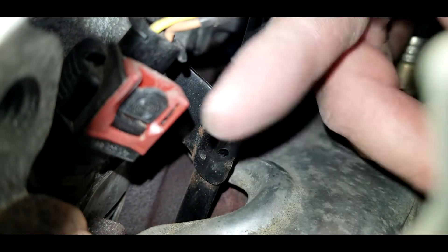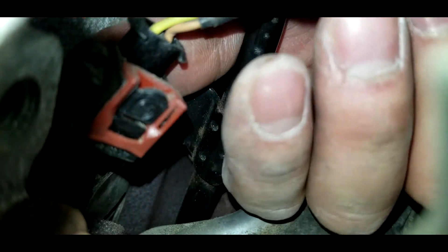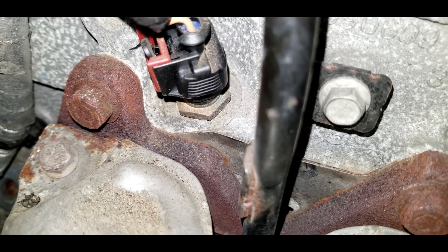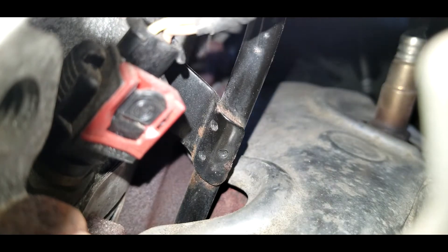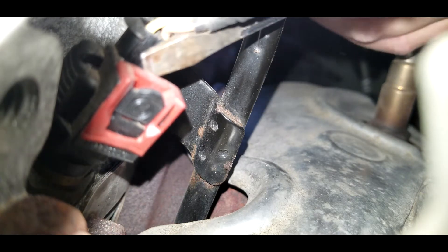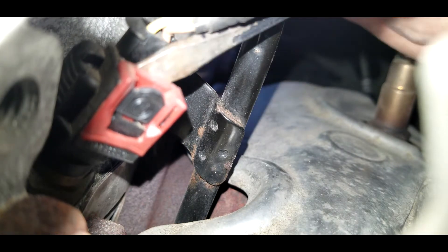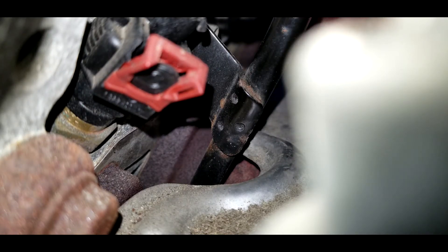Here I'm trying to take off the clip with my hands. I tried to take the red clip off with just my fingers — that didn't work. I tried pressing the button and pulling it — that did not work either. In order to take the wire cap off of the sensor you need to pry open the red clip. So what you need is a flat head screwdriver. I tried popping it from the top but didn't have a lot of room, so I decided to go to the bottom of it, twisting the flat head to try to make it come off. Finally I was able to pry open the red clip, but I still wasn't able to pull the cap off of the sensor.